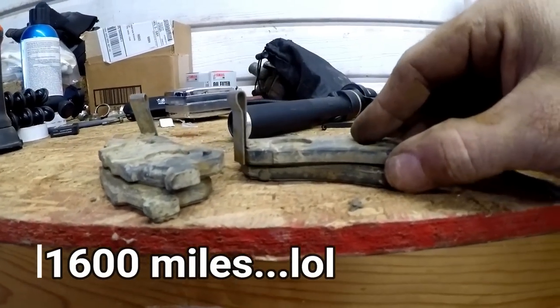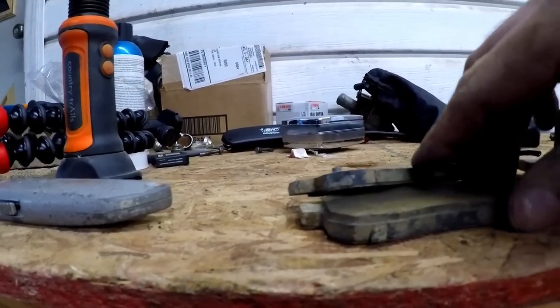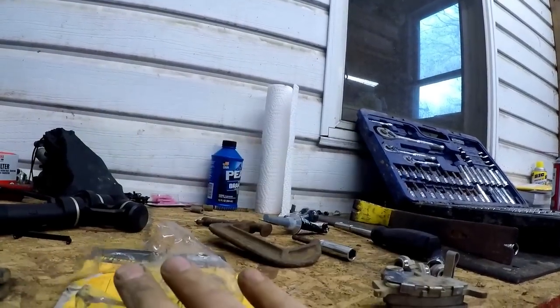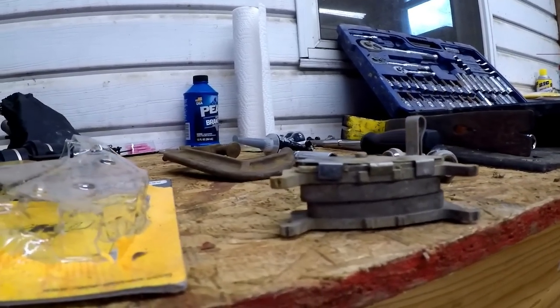I hope if you're getting ready to change your brake pads you found this video very helpful. At 1600 miles, here's what's left of my front brake pads — not much at all. Three out of these four are pretty shot and this one is getting way down there. My rear still has plenty of life left on them, which is a good thing — you don't have to change these as often. But I wanted to make sure to have all my brake pads the same kind and not mix and match, so I'll keep these for backups. Judging by these pads, we could probably go through three or four sets on the front before we need to change the back — so even though the rears are a little more of a pain, they don't need to be done nearly as often.